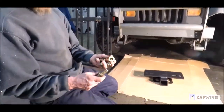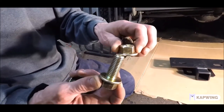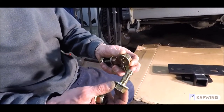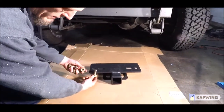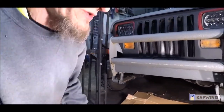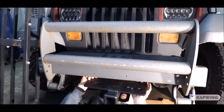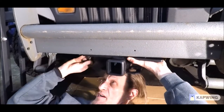Zach's got some of the flange nuts and bolts in his hand. These are heavy-duty grade 8 — I would suggest not using anything less than a grade 8 bolt. You definitely don't want this to break off at highway speeds; this is a safety issue. Another option would be to put the bolts in and spot weld or stitch weld around the corners, though that might be slight overkill. We're not intending to tow anything with this front hitch mount — it's really just going to have the basket on there with possibly a few hundred pounds of supplies. If the Jeep ever gets stuck in the woods, it will have a hitch to get towed out with, but I don't anticipate that.